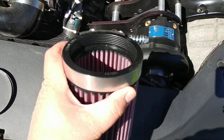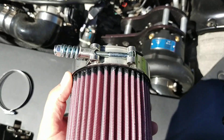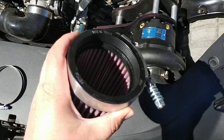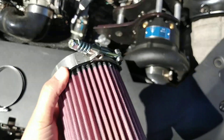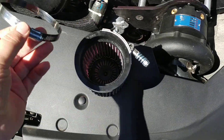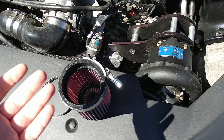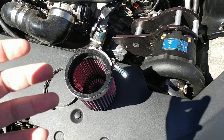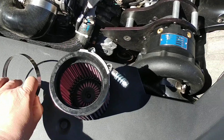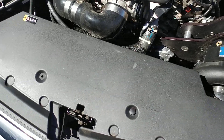I can't do that because of how short the collar is. So I've done two things. First, I'm changing the clamp out to one of these spring-loaded clamps — that's going to give this some more tension and keep it secured versus something cheap like this. The other thing I'm doing is powder-coating that metal pipe with a rough textured finish. So rather than having a smooth polished pipe, it's got a rough textured powder coat finish, and that'll help the filter grip onto the pipe.